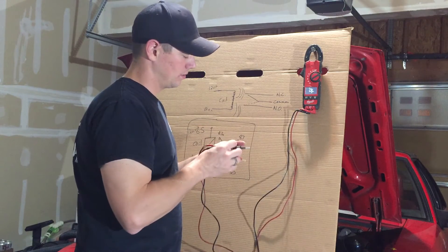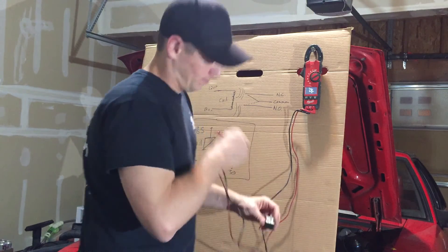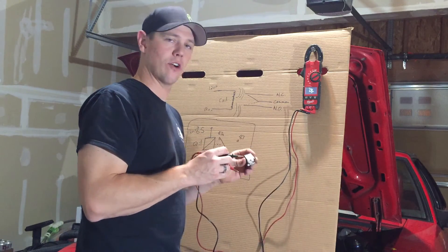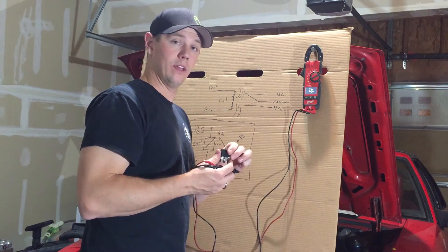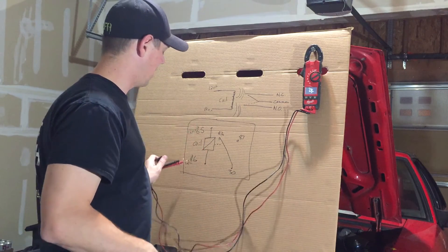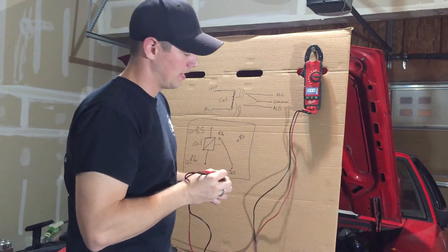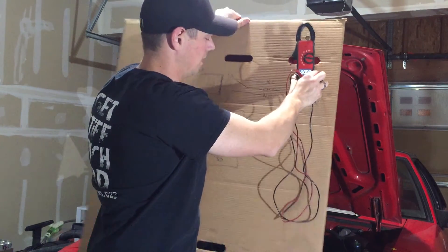So the other thing you can do is apply power to your relay and check if it changes state. A good approach when troubleshooting a relay problem is to start from the relay. First, is your relay energizing? Is your coil getting power? You can test with your leads on DC voltage and test the contacts in your car to see if you can identify where the issue is.